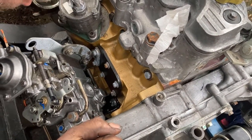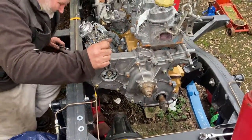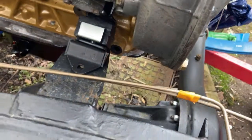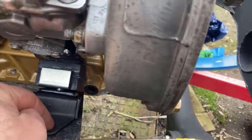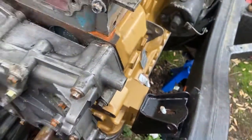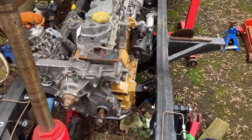So I think what we've got to do, and my glorious assistant is on the process, is drop the engine mount off the block and then see what adjustment we can get out of it. It's a bit bloody tight for getting anything in though. Well, we're still not in, we're getting closer. So we're going to have it up again and open up, give ourselves more clearance on that hole where the mount fits. There's not much we can do on this one. Could elongate those a bit. On the near side, I've opened that out, give ourselves half an inch. I'm going to take it back down a bit more, just so we've got some more wiggle room, because it'll align itself once it's sat. But it's lunchtime now, bit of buggering about after lunch.